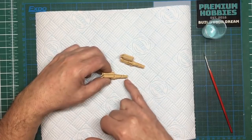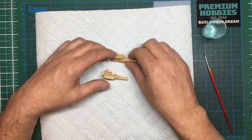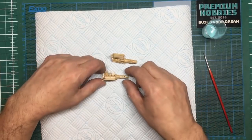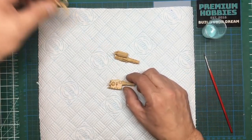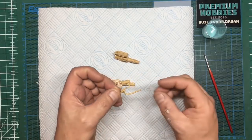The R380 gearbox had a black casing with an aluminium bell housing, so the transfer box would be aluminium, this area here will be black, and this area will be silver — and that's the same for both of them. As far as I'm aware, army gearboxes were just standard civilian colors. The air box, turbo, and everything would have all been painted green as well.